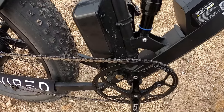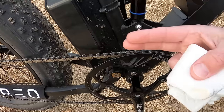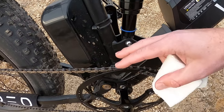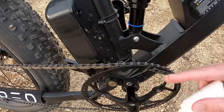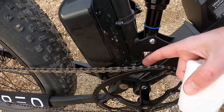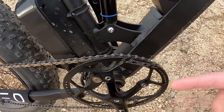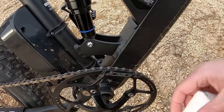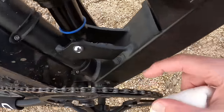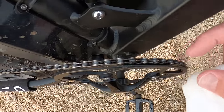A fix for this, in my opinion, would be very easy. A chain guide — so normally if you had a front derailleur, it would kind of protect it and keep it from coming off too far because it would be moving it between three different chain rings. On a single ring like this, all you would need would be some sort of guide or something that would stick out maybe from this post here, or be attached down here, that would protect that and prevent it from being able to go too far and fall off the chain ring. There is a little guide on the front of the chain ring already, but not the back side.